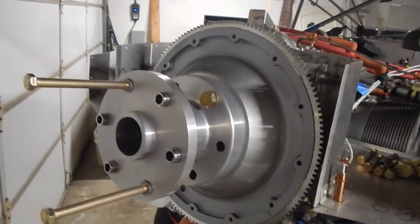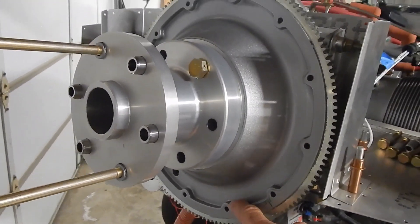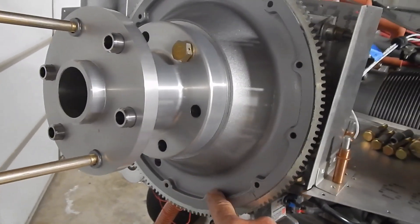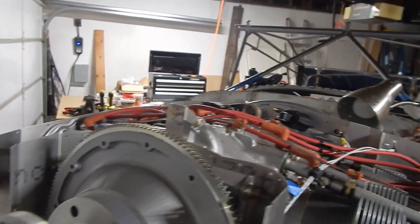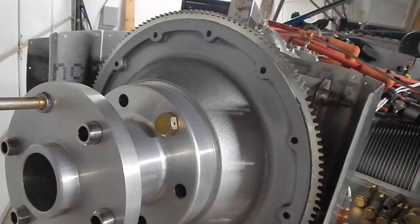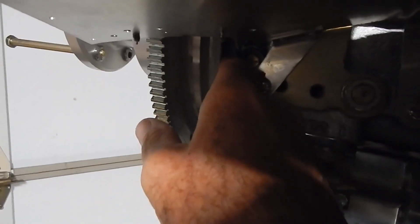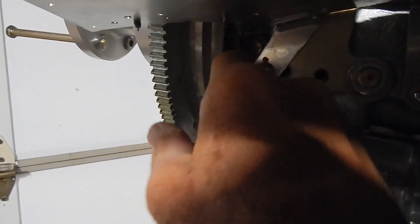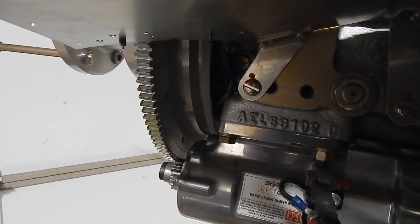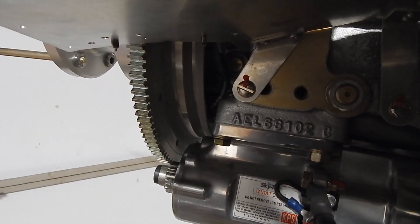That's not what I expected — I put the good sensor on the bottom, and I was expecting to get both sparks from both coils when the magnets went past. I only got one spark again — the same coil, same magnet, same position. I got in there really tight with a flashlight, and looking at the reference lines it appears the bracket may be a little bit low. So I'm going to start adjusting it, because that's a known-good sensor and it should be sparking when the flywheel magnet goes by.